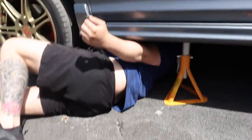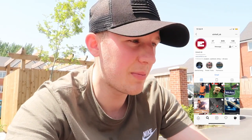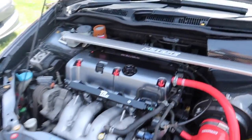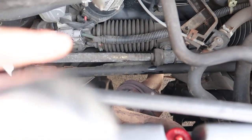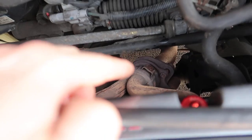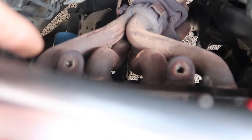The anti-roll bar is done and dusted - that's number two off. The IronHill drill makes it so much easier. Under the car we've taken the sports cat off, the exhaust is off, the mid pipe is off. I'm going to do my best to get the bolts off the manifold and try to drop this section as one - take the manifold straight off and drop the whole thing. I can just about see the bolts - two down there and one on each side.